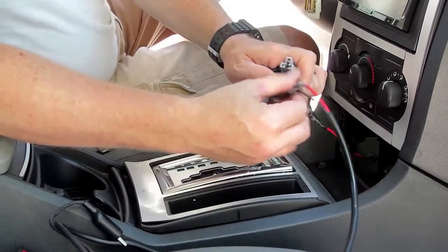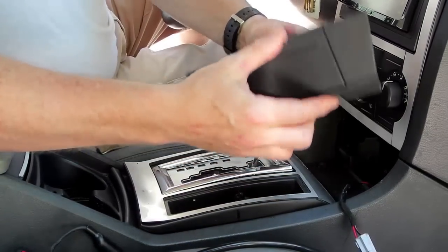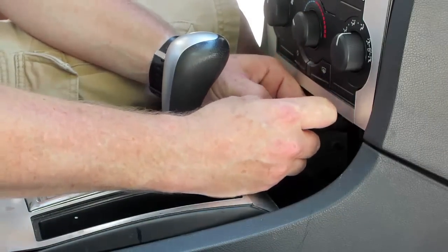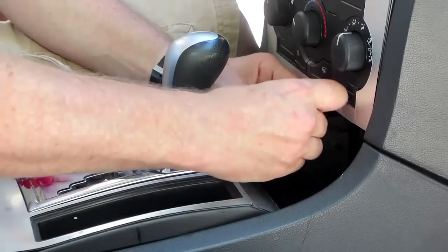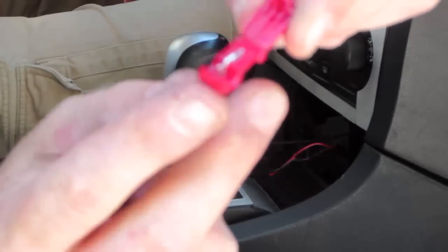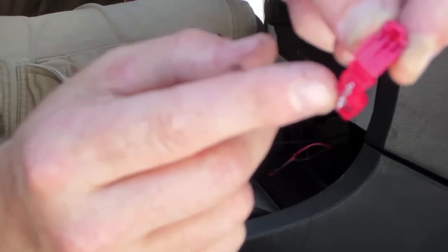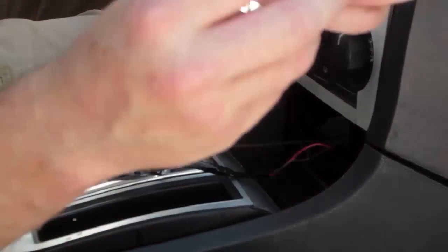All I'm going to do now is attach these wires and mount this into the existing stock hole, put it back in, and I'm done. Wiring up the USB charger should be a breeze — just get in there and separate your two leads for your cigarette lighter. What I'm going to use is T-taps. It clicks onto the wire without damaging it, has a spot for the male spade to go onto it and another area for the wire, and then your male slides into it — that's why they call it a T-tap.